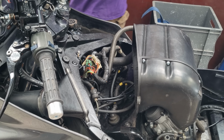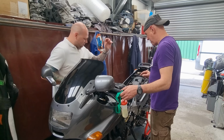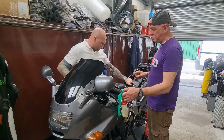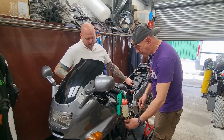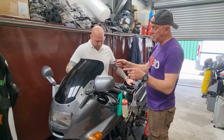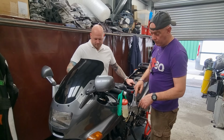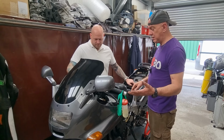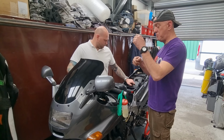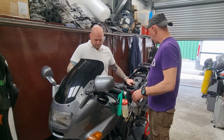Right, let's get some fuel hooked up, give it another go. Engine troubles, and look, he shows up there. Right, this is one of those problems that has just disappeared, and I don't get it. So what's happened is I had the plug out, I couldn't really see a spark to it. There obviously is. I switched over leads and ran it up, and all four of the headers were getting hot. And it didn't sound like it was dropping a cylinder again. So I've switched them back again, let everything cool down, the headers, so I can check it again, fired it up, and it's all fine.